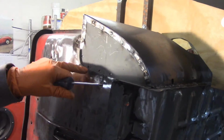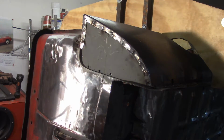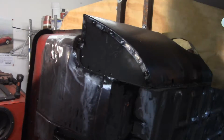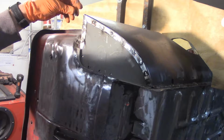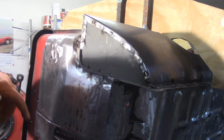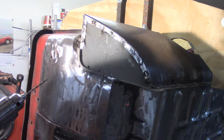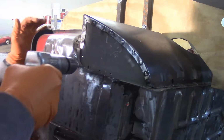All right, so then I'm going to put a little set screw here and probably one here and clamp those two together. All right, so I got a small drill bit here and slightly larger diameter set screws. Keep saying set screws, sheet metal screws I should say. I'm going to put one here and one here close to this hole. Going all the way through these, you want your drill bit to be a little bit smaller than your sheet metal screw so it can bite on something.